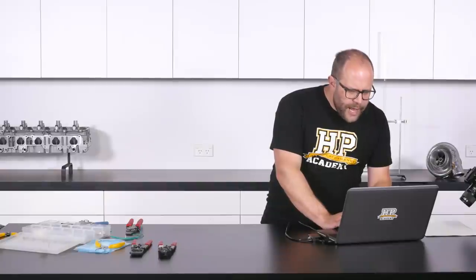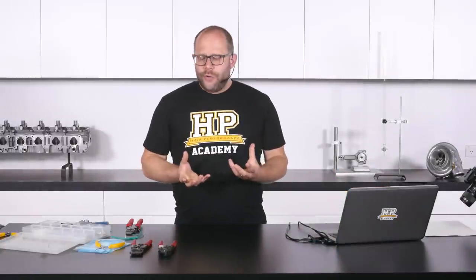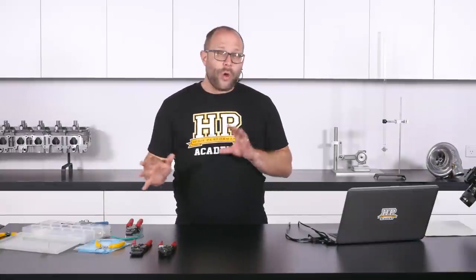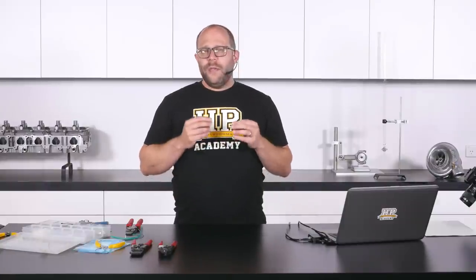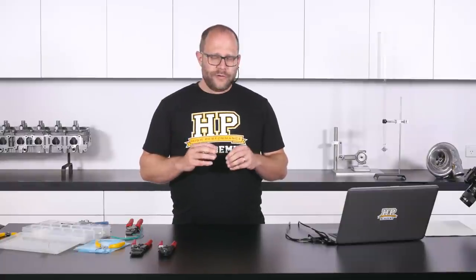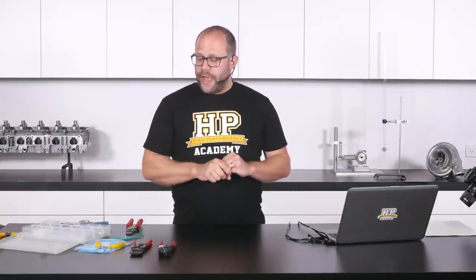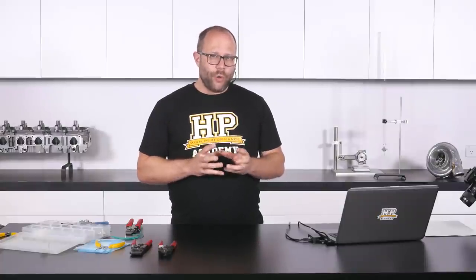Peter Parker has asked whether the wire alloy composition is important and if there's a preference. The wire I use comes down to two types: TXL wire which is pure copper wire as far as the strands inside, and the mil spec or Tefzel wire which is also copper but it is actually tinned or tin coated. It's not going to matter when it comes to splicing because you're going to put the whole system under enough pressure that it is going to essentially all be cold welded together.